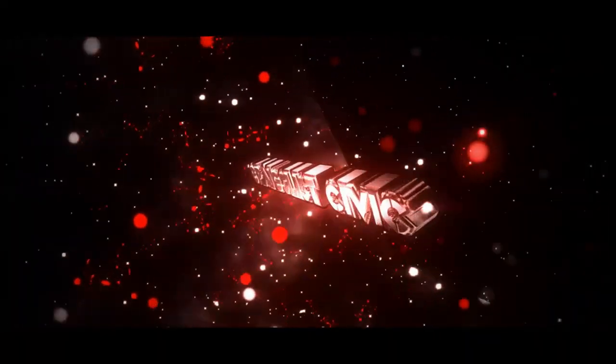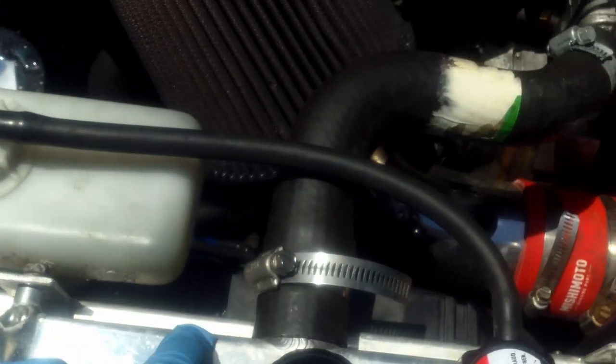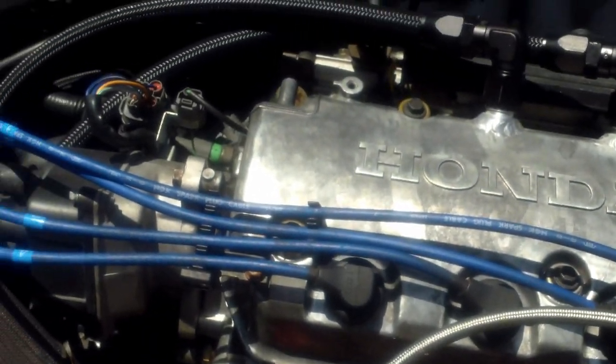What's going on ladies and gentlemen — today on the Craigslist Civic we're doing another head gasket. The last time we did a head gasket I think I got a counterfeit part. The problem we're having is we are pushing water under boost up into our cooling system. There's no mix of fluids that I can tell — no milkshake, nothing like that.